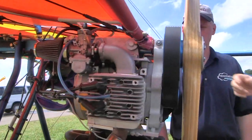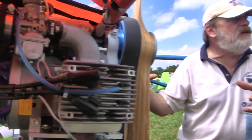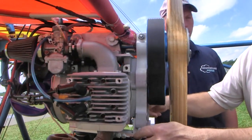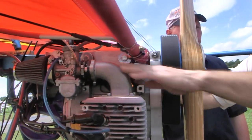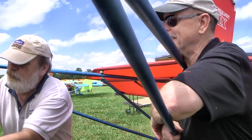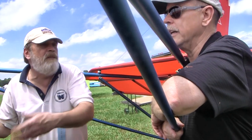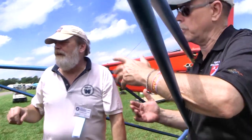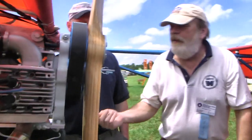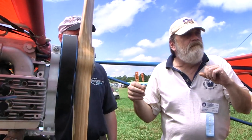It's a hard engine to install because of the opposed cylinders and dual exhaust. If you put it on top you've got a punchy exhaust through. What we did was invert the cylinders — we removed them, turned them 180 degrees, and had to turn the pistons too. That takes the carburetors from being underneath to being up top. The carburetors have to be on top because of gravity — when they're underneath, fuel pools in the intake manifolds and it won't idle.